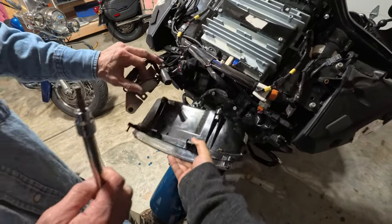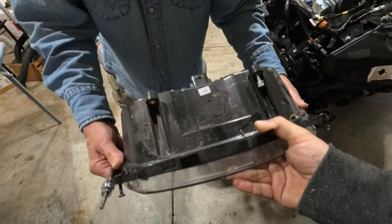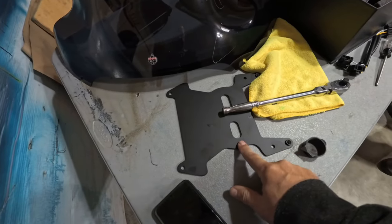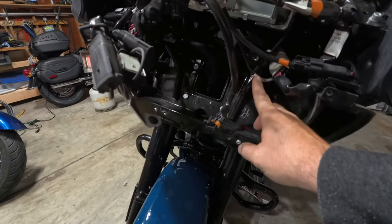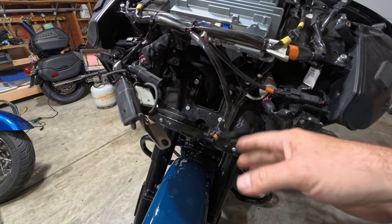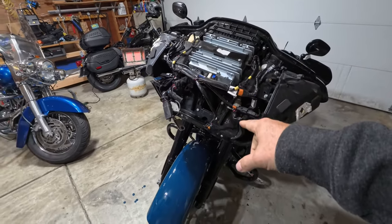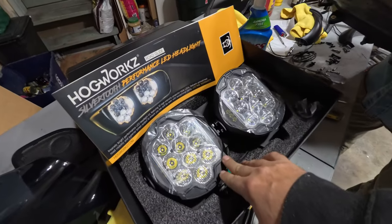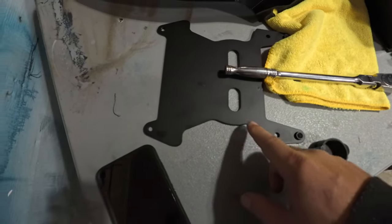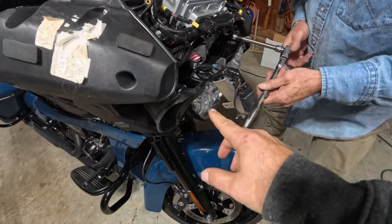There it goes — and there's our electrical plug. You just lift and separate. All right, so now we have the backer plate that should bolt into the original locations on both sides using the stock hardware. We'll hit that with some Loctite so nothing vibrates out. The headlights are already mounted up to a plate, which should just go in and bolt into the other locations on the plate.